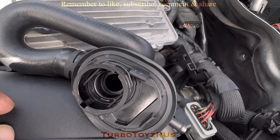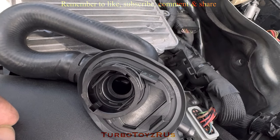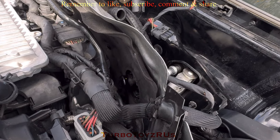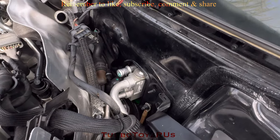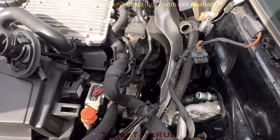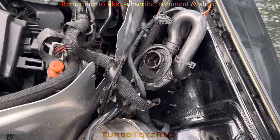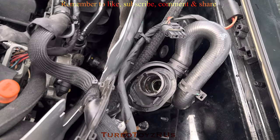The grooves on both sides show you it's not a turning locking mechanism — it just goes straight into the two grooves that are opposite, and then the locking retainer clip is what holds the male portion of the connection inside. I'm just waiting for the WD-40 to soak in and lubricate the two plastic pieces, so I can pull them apart, take out this old one from the back side, and then put in the new one. Finally I got the piece off — this is the replacement part right there and that's the old one, which gave a really hard time to come off. The O-ring in there was like seized on the other plastic portion.